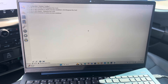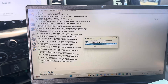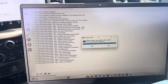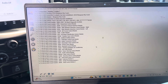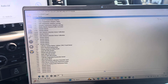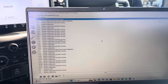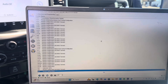First thing you're going to do is connect the vehicle. Once it's done reading, it's going to give you the option to save a profile — select yes. And then from there, you're going to go to the Configuration and Programming tab, and then down to IPC Module Configuration.